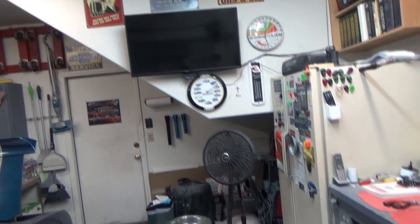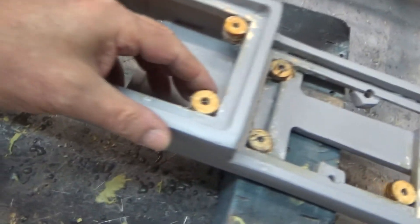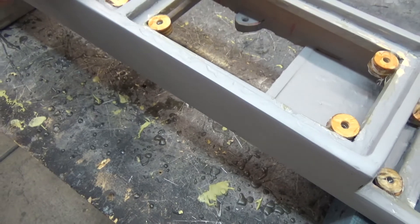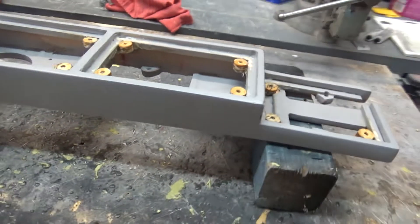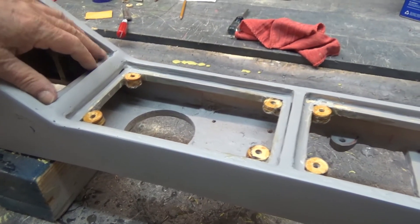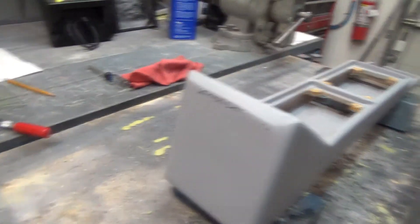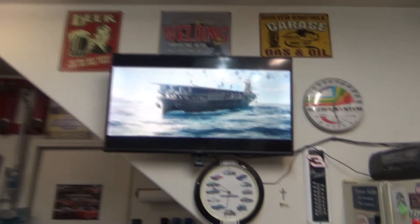Hey tubers, it's late Sunday afternoon. I got out here and glued the rest of these in — they're all resin and cloth, clothed in, so they're definitely part of the structure now. Now we need to break out the body filler and start filling and massaging this thing. Once we get to 220 grit we'll make the panels and start fitting those, but all that has to happen before the final stages of primer.